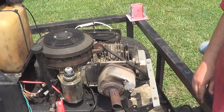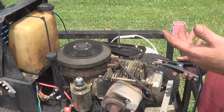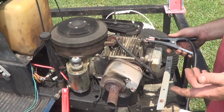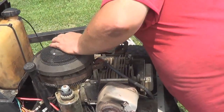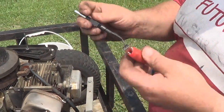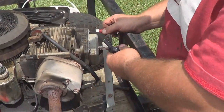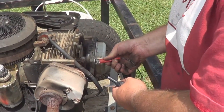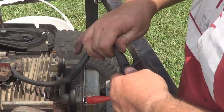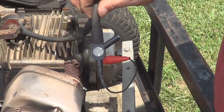This one's bad, but I'll show you how to test it. If it doesn't want to start, you know you've got your key on. You want to see if it's firing. They make a variety tester or something like this, which I ordered from a small engine shop — you can see it through the window. Take one end, put it on a good ground somewhere so you know it's good. The other end goes on the spark plug wire. Then when you turn it over, there's no spark in there.